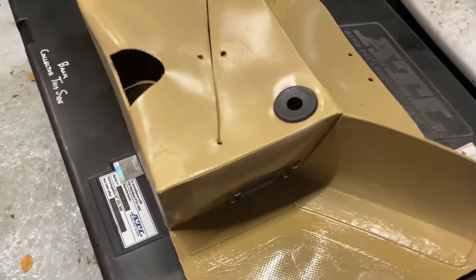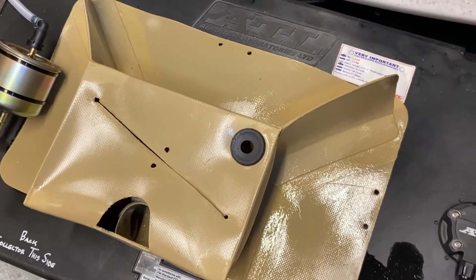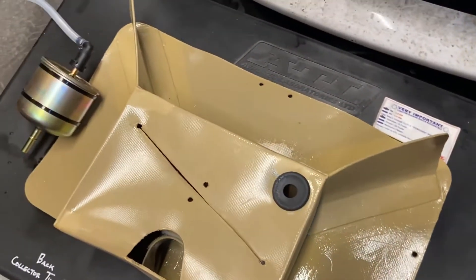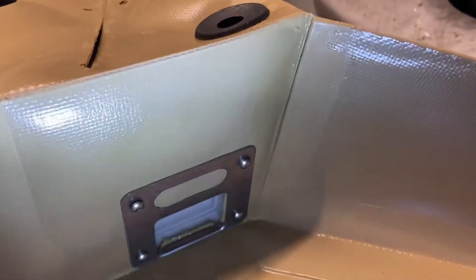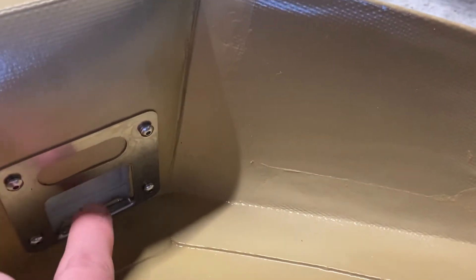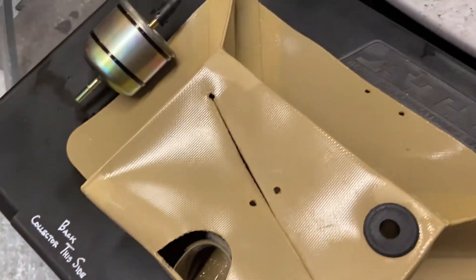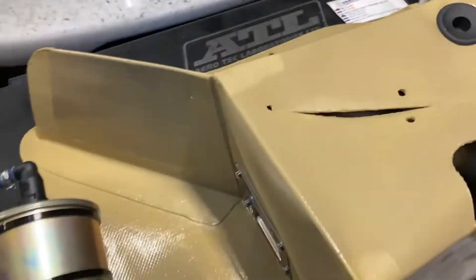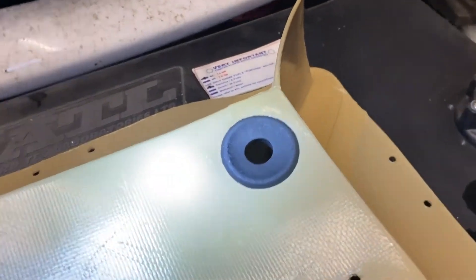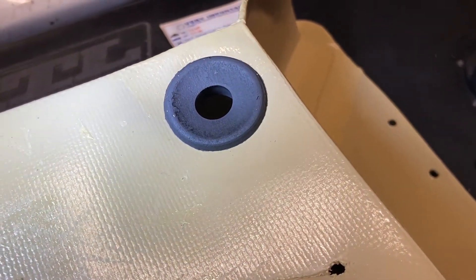The collector is out now and we can go around it in a bit more detail. On the outside it sits at the back as you can see — we've marked it up. So it sits like that within the tank at the rear. Under acceleration the fuel moves to the back and those two guiding vanes effectively guide the fuel to these trapdoors which are one-way trapdoors. As the fuel comes in they just open but they won't open the other way. The theory being — and in practice — the fuel collects in this area in this little box so to speak. Where the fuel pump sits it's got all the fuel ready to pump. A clever little design. This hole on the top is for the return, so the return just tops up what's effectively a swirl pot — well not really a swirl pot.